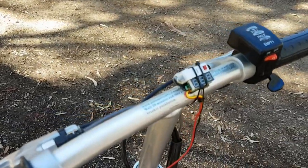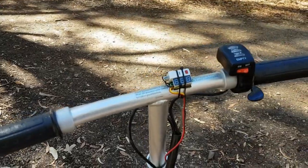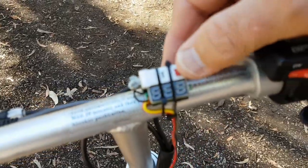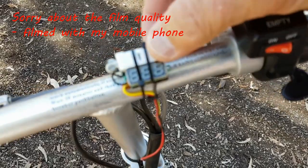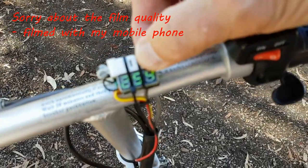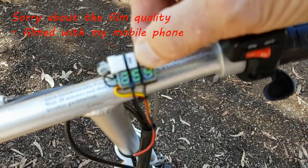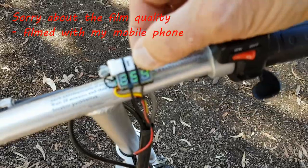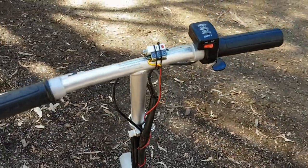There's no battery management system on my lithium, so I could never see if they were running too low. So recently I just put this little voltmeter on it that I bought on eBay. I can see my voltage there — it's 25.4, which is what they charge fully up to. So I can keep a check on it getting below 20 down to 18 volts or something, and I'll stop riding. See how far it goes.